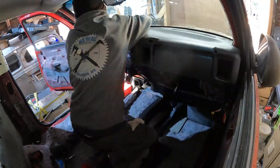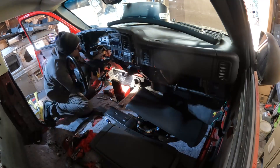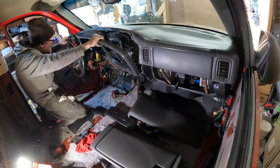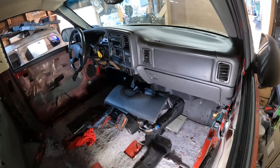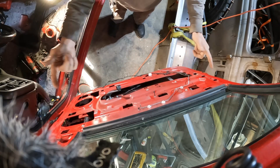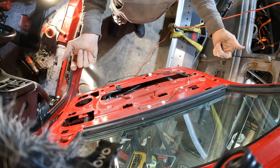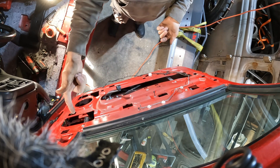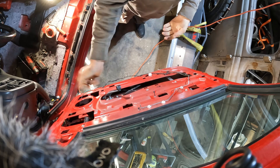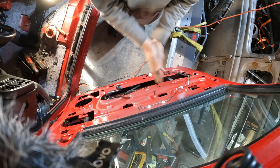All right, we're jumping right into the interior. Just so you know, if you are doing the power windows and heated seats and all that stuff, you do have to swap out the whole dash, climate control, everything — it's just a lot easier so everything matches up. We're also converting to electric locks, changing the handle to a painted handle, putting in the SS mirror which has a turn signal and possibly defrost, and installing all the heated seat controls. Electric everything — let's get to it.